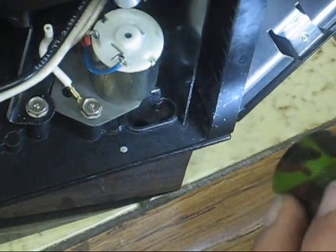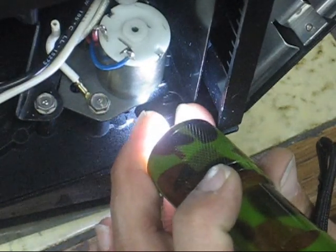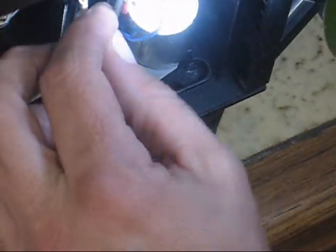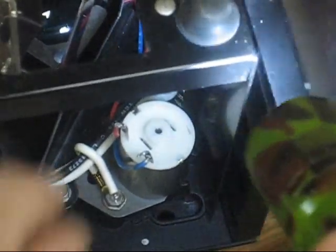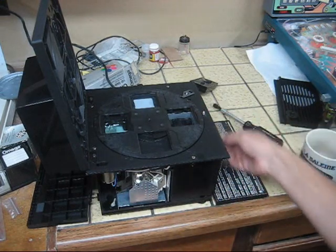Weasel in and get that other one on the far side there. Your wire harness - just push that down and go ahead and bend your wire holders back over. Get that other one in there - same thing, just kind of bend them over so they're holding the wires just like they were. Okay, so we put our bulb back in and the fan's running.